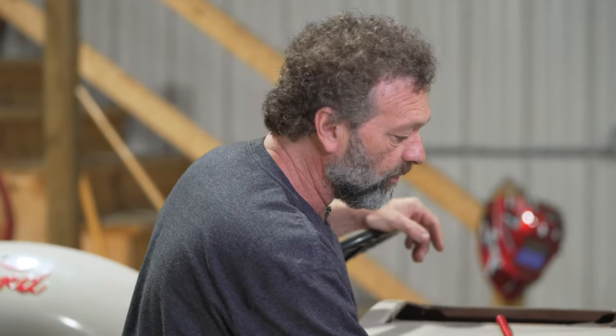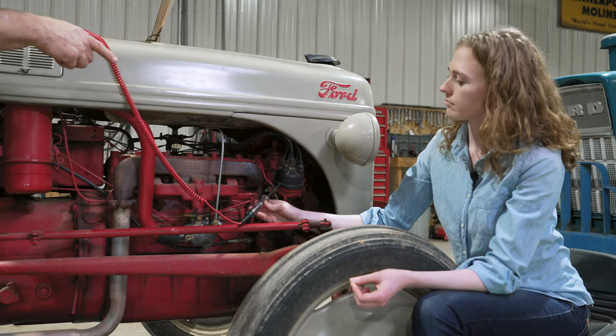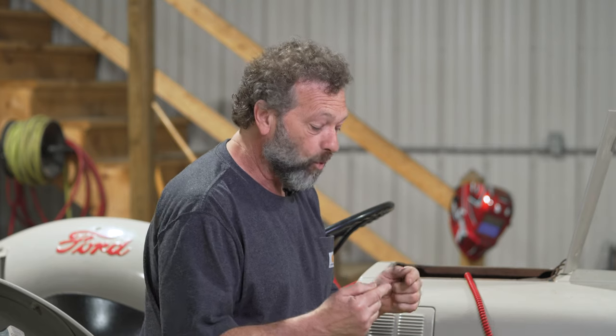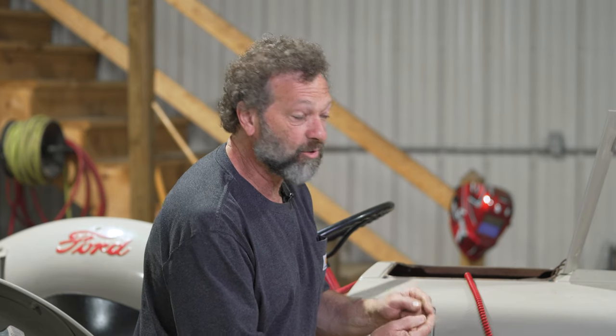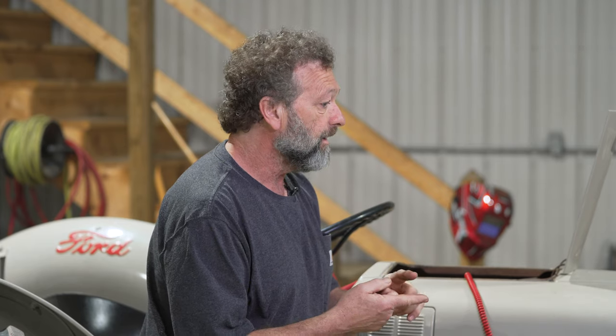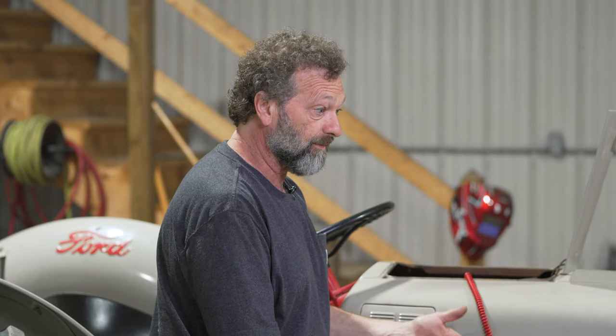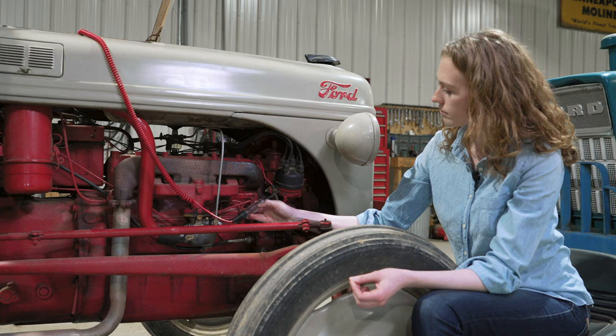Now Rachel's tool is going to work. What we're trying to do is: when I roll the engine over, that light should come on and off, on and off. If it stays on, your points never make contact — so bingo, your points are bad, need to be cleaned, readjusted, or the gap is incorrect. This is also a good way to test if your gap is right because the light will not flash if it's wrong. Let's see if ours flash.